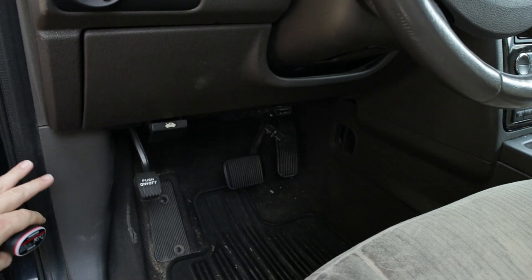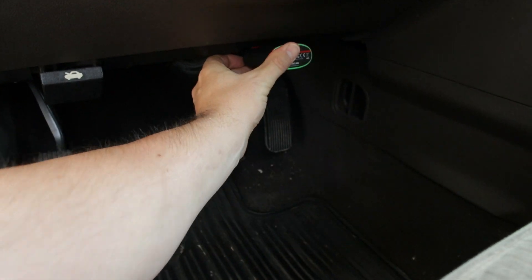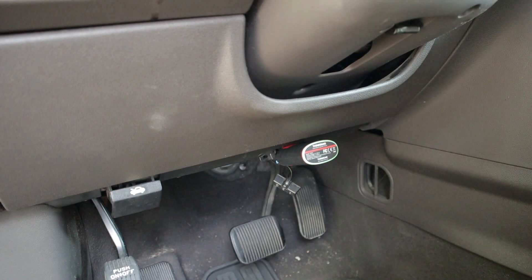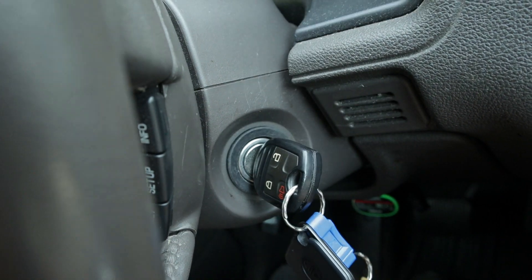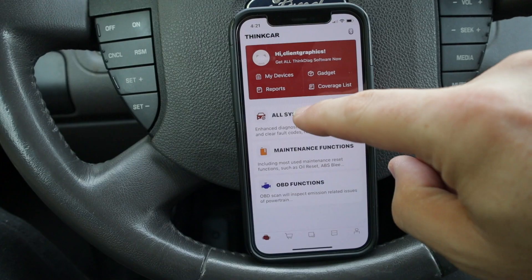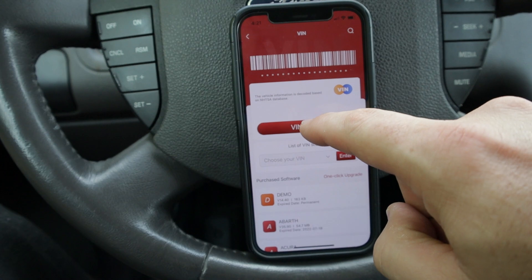Typically, you'll look somewhere on the driver's side, and here we have a port for our OBD2 connector. Got that plugged in — sometimes they're down here, sometimes they're way up here, sometimes they're over there. Green is good. Go ahead and put our key in the ignition and turn it on, just so that the accessories and the lights are all lit up but the engine isn't running. Let's get to all system diagnostics and go ahead and do our VIN scan.